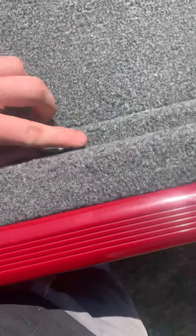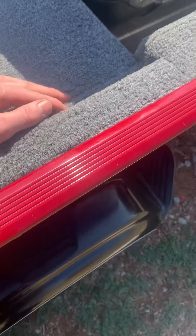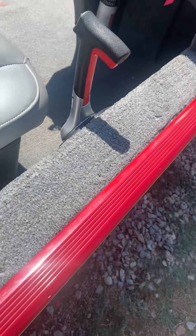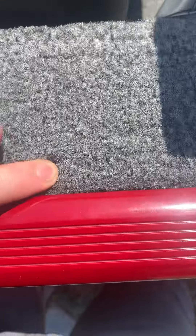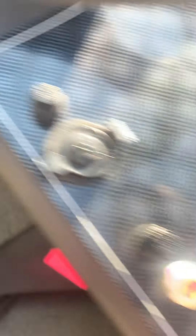Sorry it's kind of windy outside. To get this back piece off, there's a screw there, screw there, screw there, and one there — those are square head screws. If you use a flat or phillips head you will strip them out. For this piece right by the throttle, you've got a square here, square here, one there, and one hiding in here — four total. Just push it and it'll pop to the side. You don't have to pull it all the way out, just enough to pull your wires out. Follow your hole up here down and you'll find where it connects, then just cut those two wires.